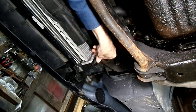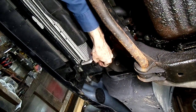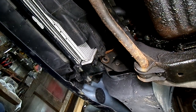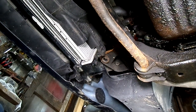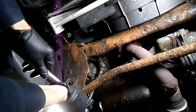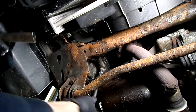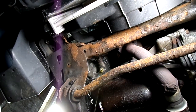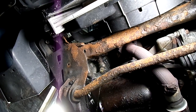The coolant has stopped, so now we can close the drain. The next thing we're going to do is remove the block drain. That block drain plug is a 10 millimeter headed bolt. Let that drip a little bit and we'll put the plug back in.